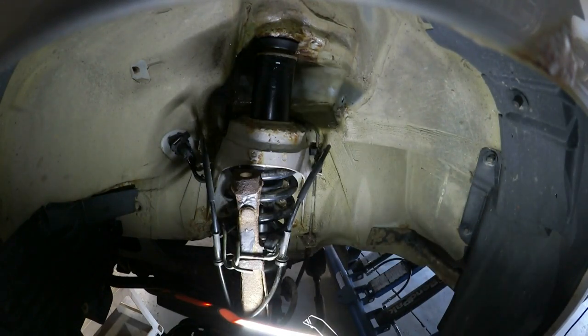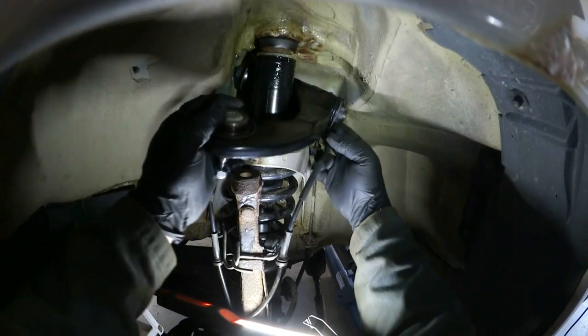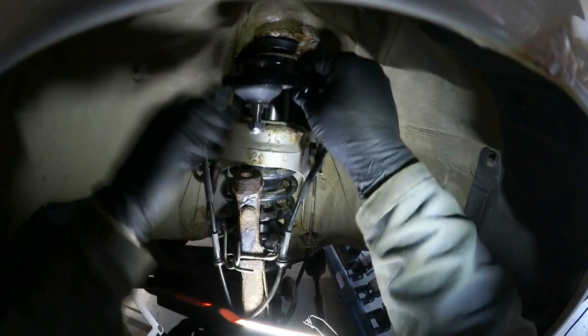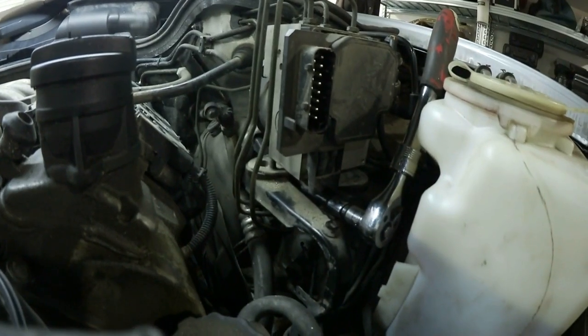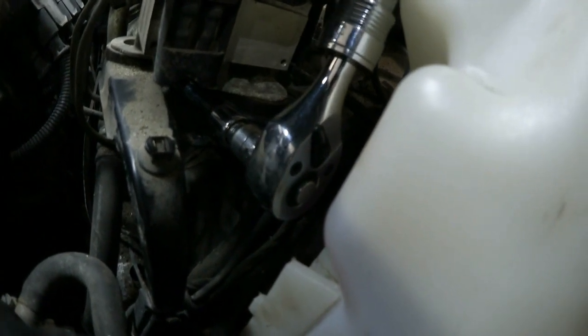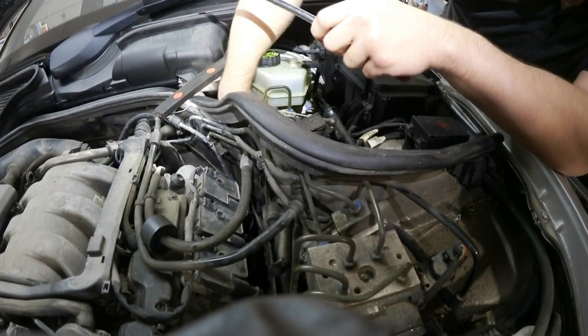Okay, so I am now getting ready to put the driver's side upper control arm in. Okay, managed to get the long bolt through the control arm. So I'm just going to snug that up just enough to keep everything in place, and then finish tightening it up when it's on the ground. And that pretty much wraps this up. Thanks for watching.